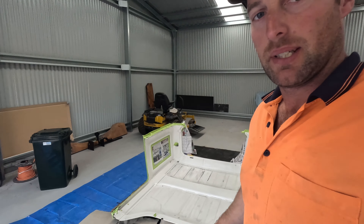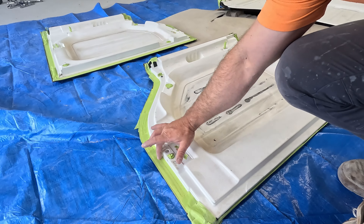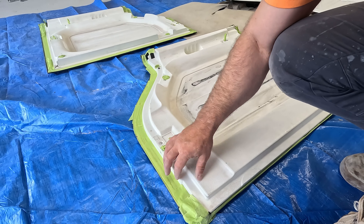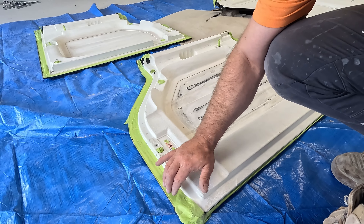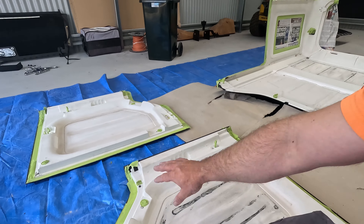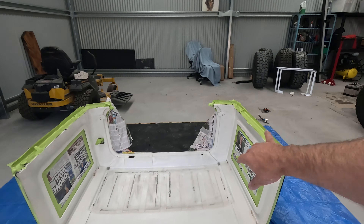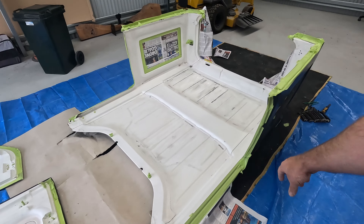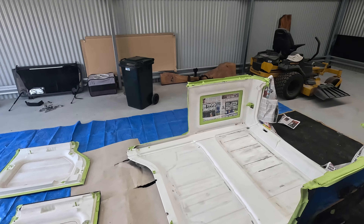Pretty much all prepped. So we've got the two freedom panels. I've decided to tape up the edges even though they're white underneath, because this is the sealing surface against the rubber, and because the Raptor is even more textured, I don't want any more chance of leaks. I've taped up the edges on both and filled the screw holes so they get bogged up with Raptor. On the actual hard top I've masked the windows and where it seals along the bottom. I'll do the remaining edges when I flip it and do the top side. Pretty much ready to start throwing some Raptor on.